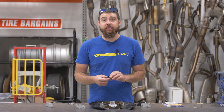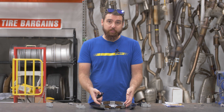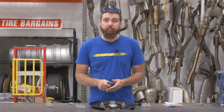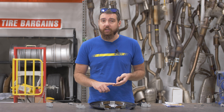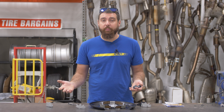This is a great option for budget drift guys because it gives you the opportunity to enhance the performance of your factory parking brake without having to add a hydraulic setup or anything else. Keep the factory interior — all sorts of options like that. It reduces the stress on your parking brake cables; they won't stretch as much and you'll get a lot more clamp load with less effort. So all benefits.